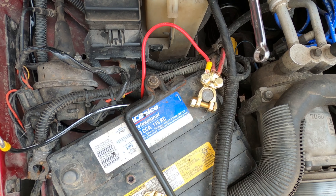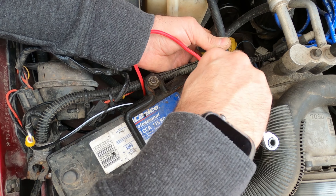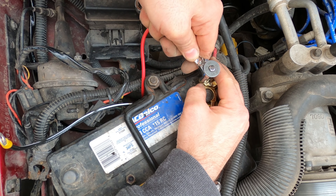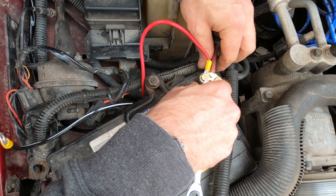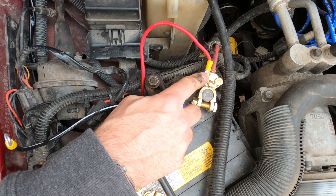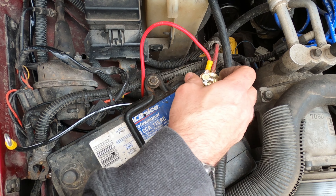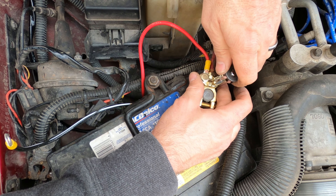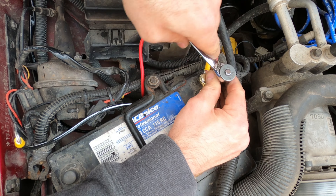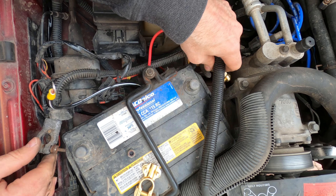I really don't like this — I'm going to take it apart and redo it. Now the fun of tightening this down and keeping the wire harness where it should be. A bit easier with this gear wrench tool. It's definitely easier to have this one tightened down first, then do the final torquing on this side because the wires going into it need to be nice and tight. I'm going to loosen one side so I can tighten this one down first. There, that feels pretty good. I'll take it off the battery post for now while I modify the negative.